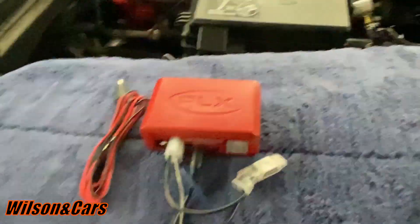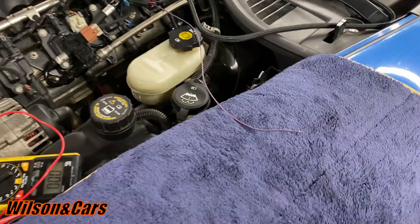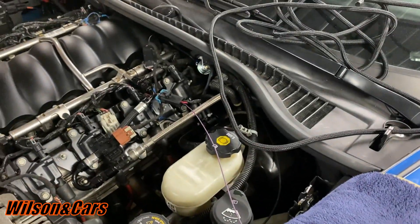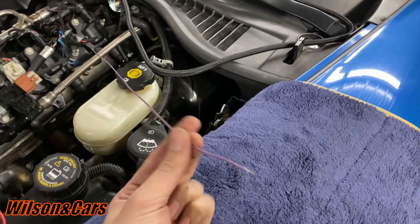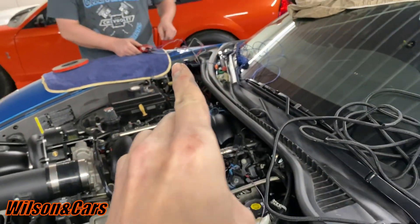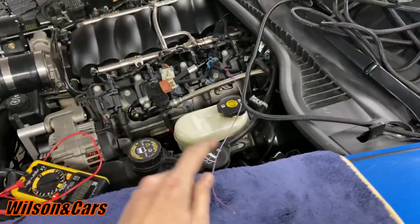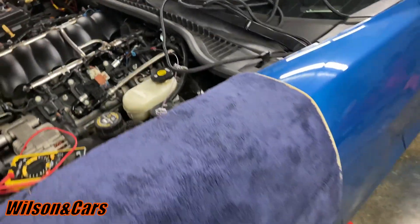The plug came with those pins — all you've got to do is put your wire on it, crimp it up, push it into the connector, and it clicks in. That's when you know you've got it. From the factory harness, what we found out is that the purple wire should be the signal wire going back to the ECU. We're going to connect that to the gray wire they sent us for the zero to one volt output, and hopefully the narrowband works — crossing our fingers.